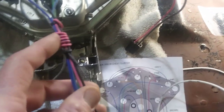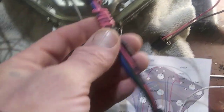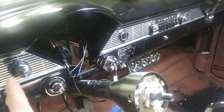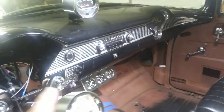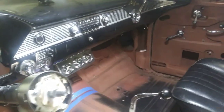I got an ignition wire here — a 12-volt power wire supposed to go to the temperature gauge — but since I'm not running that temperature gauge, I just shrink-wrapped it and zip-tied it up for maybe future use if I ever put a gauge in there. It should all just plug right in once I get them tidied up. I might get some different dash trim; I got a buddy who might send me some. I even got light bulbs for my gauges, so that's cool.